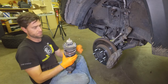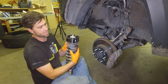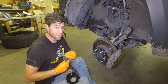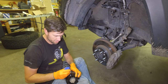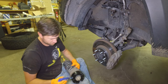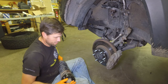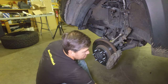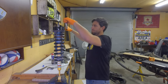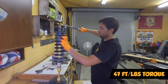We're going to hold this up, slide that over the top — it slides over all those studs. Then we're going to add some Loctite to hold everything together. This section actually gets the old hardware screwed down on top. I'm also going to take this over to the vise and tighten it down to factory specs, which is 47 foot-pounds.